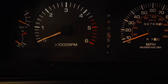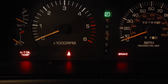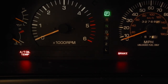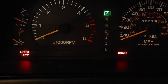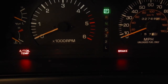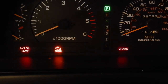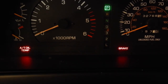Now we're inside the truck and we're just going to turn the key to on. Watch our lights there — there's our check engine light blinking. I missed the first go around so we'll count again in a minute. So there's two blinks, that's the first of our code. And that was eight, so it's a code 28.